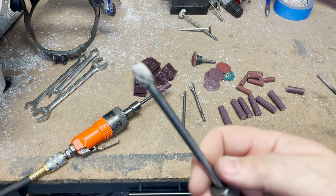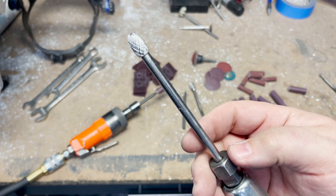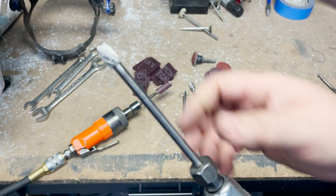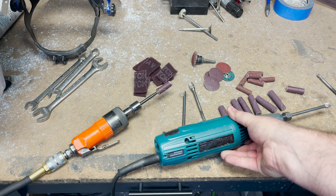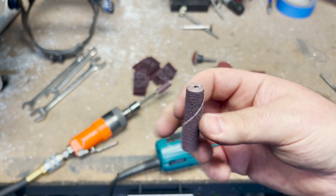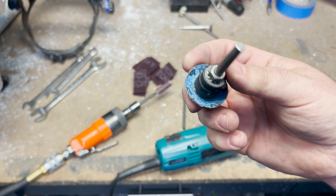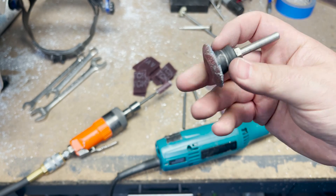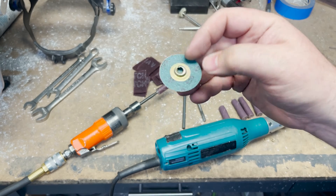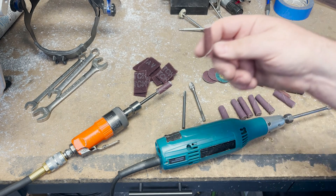The GDO 906 grinder — this is the double-cut burr. This is the three-eighths from Head Games Motorworks, and this is going to make everything nice and smooth to sand. For sanding, I start with 60-grit first — the 60-grit is going to make all the grinding marks go away. Then we hit it with the sanding disc. You might want to see my other videos where I modified the disc holder so it's nice and cushy and goes around the chamber.